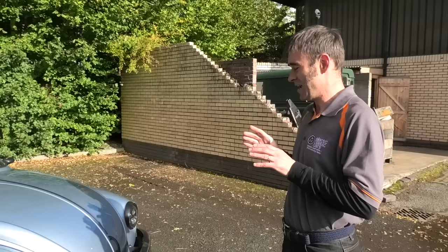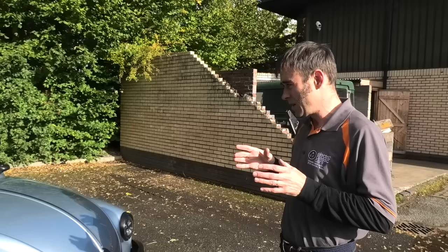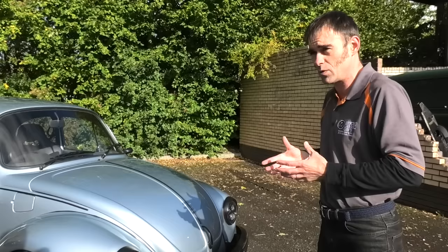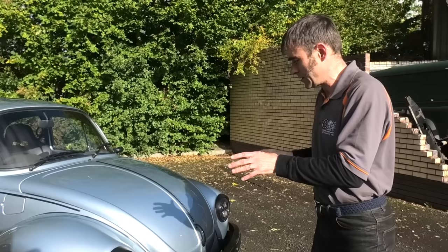So the beast. The first thing I had to sort out before I even thought about putting 600 horsepower into this thing was how is it going to cope with that power and the speed that comes with it. Coming from my rallying background, the first thing I did was lighten the car up, because whenever you drop weight off a car that's free power. We put carbon fiber bumpers on the front, fiberglass wings on the front and around the car in different places. The car ended up being about a thousand kilos with everything on it — so it's a 600 horsepower per ton vehicle. We're talking hypercar territory.